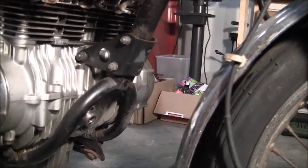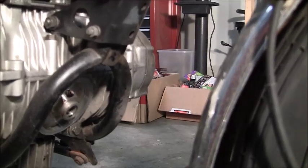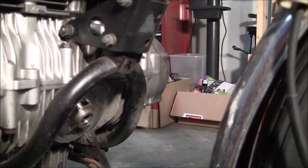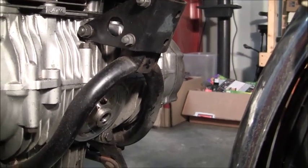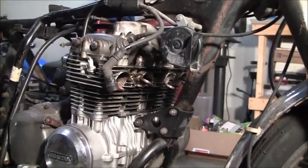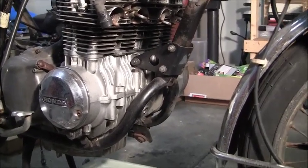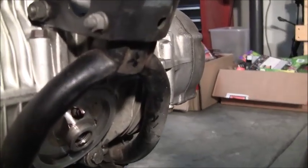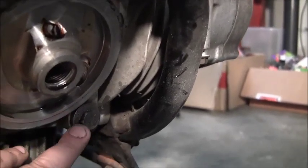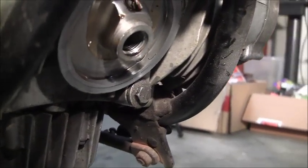out of the frame. I didn't record it because it was a mess. I tried everything and then basically ended up cutting off the washer, which I skimmed up the housing a little bit, which is fine because I'm going to replace that anyway. It had some broken fins on there. One other thing you'll need to do, hidden behind there, right there is another drain bolt. Go ahead and crack that open, drain the rest of the oil.